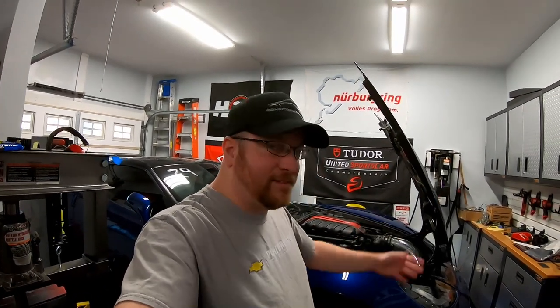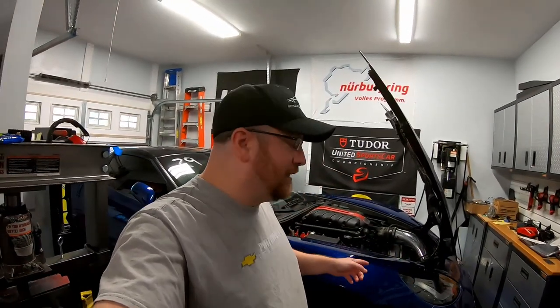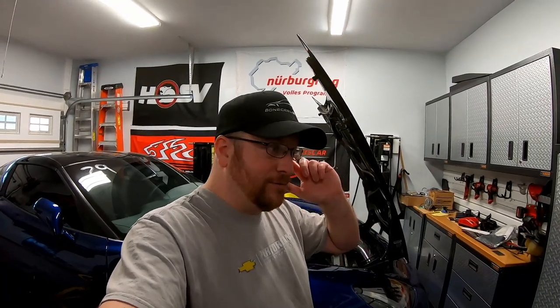That was the beginning to end of using that filter wrench on the LS motor. I wish I had seen that tool years ago — I'd never seen it before, and you never know what you're going to find surfing Facebook. I'll have a link in the description for that filter wrench. It should help you especially on LS motors. That is the fastest I've ever changed the oil on my Corvette in the 13 years I've owned it. Back when I was on a stock exhaust you could fit a standard strap wrench on it, but once you modify things there's no room.